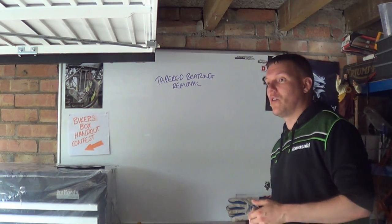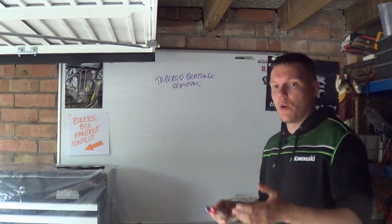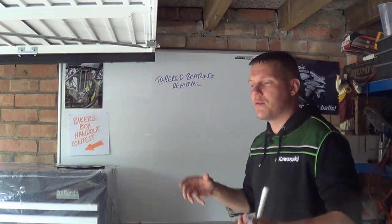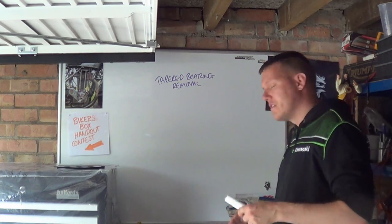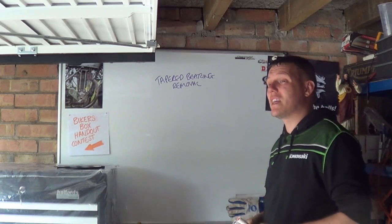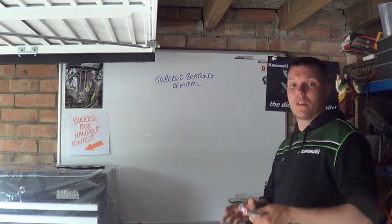tool of how to install tapered roller bearings properly and so on and so forth, one of the problems you can have is if someone hasn't preloaded it properly, hasn't fitted the seal, hasn't done something, really abused it, whatever, you might buy a second-hand bike where the tapered bearings themselves are fucked, the race is all chewed up, it's just shocking, horrible and crap.